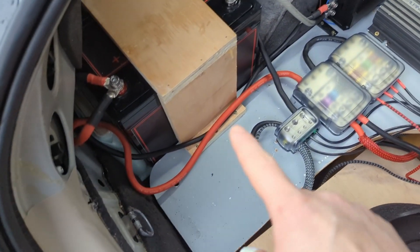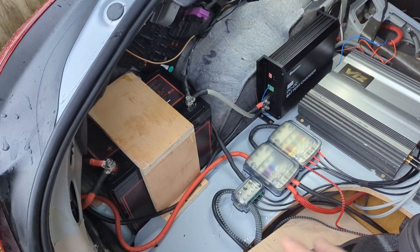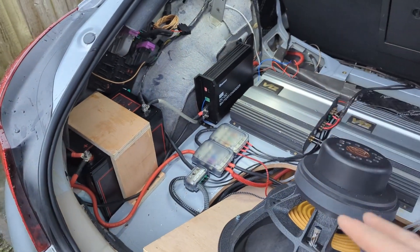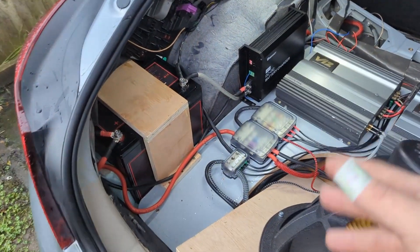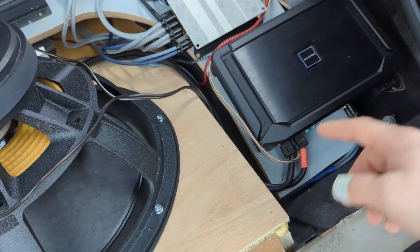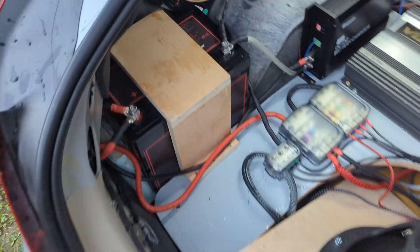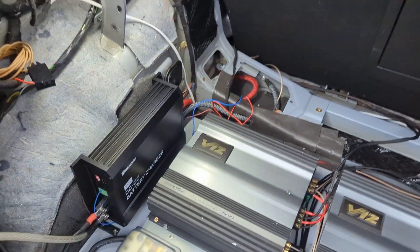The actual wire thickness and gauge isn't finalized yet. I put literally what I had to cut as little as possible, because when the system settles, only then I'm going to run properly sized wires. So right now I have 4-gauge running here, which is overkill because it's only feeding the front subwoofer — 10-gauge would be perfectly fine. I just have some lugs for now.